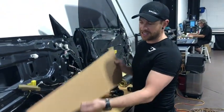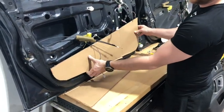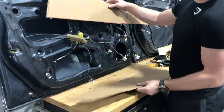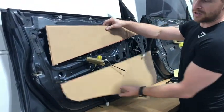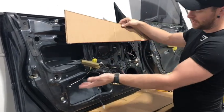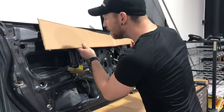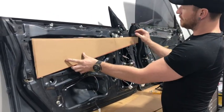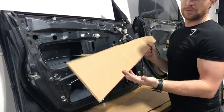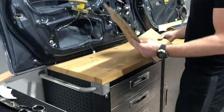We're going to head and cut that out and try to fit it in the door - that's as simple as that. Now, I don't throw away the top part, because I'm going to use that to do my template for the top part as well. The cool thing is the angle that you've created is the same angle as the bottom part, so if you've done your angle right, that is going to form the basis of your top template. I'm going to sit that in there - whilst I might need to extend it a little bit up or cut out here for the door latch, I've got a basis to work with straight off the bat, which is going to save you a lot of time.